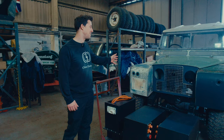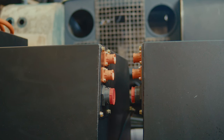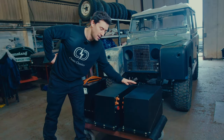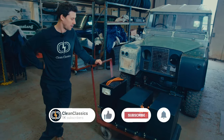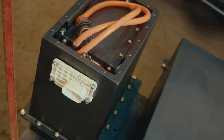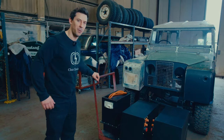Obviously we'll be electrifying the Series 2A as well. We've basically got the whole EV system ready. Here are the batteries ready for the system next to the car — 40 kilowatt hours of Nissan Leaf batteries repackaged to fit into a Series Land Rover. These two boxes here fit underneath the seat box where the fuel tanks originally live, and the rest of the battery sits just in front of the motor in the engine bay, nestled low down behind the front axle. It's a good couple of hundred kilos, but once repackaged like this it's really easy to just bolt them into the car.